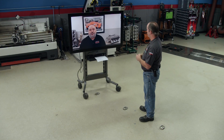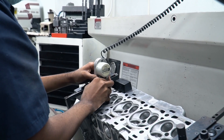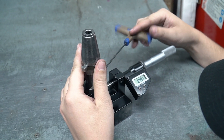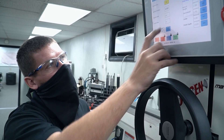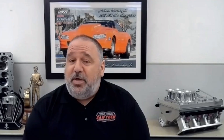Depending on the type of block, we don't have to deal with the cam bearings in this one because it's a Coyote. We can do a little bit of work on the cylinder head — tell me about your cylinder head department. Airflow is paramount. I had a student ask me this morning how to get to 8,000 or 9,000 RPM, and I explained that if your heads won't flow air, you're not going to get there. You can go overboard with airflow — the heads have to be matched to the cubic inch underneath. That's one step that's often overlooked, and if you're not sure how to port these heads, you can make them worse than when you started.